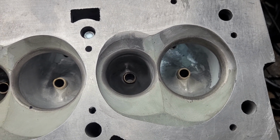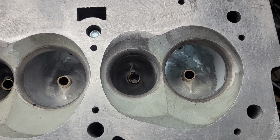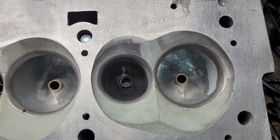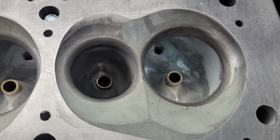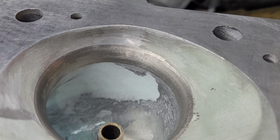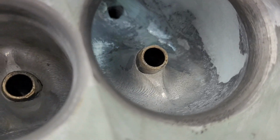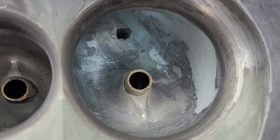Okay, not small block stuff. These are actually the street design. I actually had to mark on it, street head, because, you know, I get carried away, right? It's an interesting design. Some of the interesting facts on the old is, take a look at how low that chamber is. It's only 6 degrees. Six. Okay, makes your turn much more difficult.